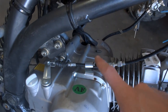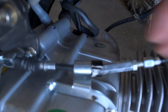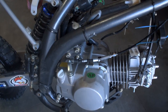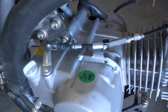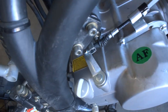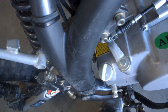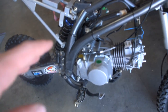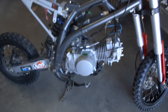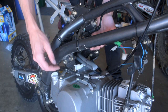Long story short with the clutch cable, we ended up building a little spacer — we notched it and slid a piece onto the clutch cable because this is meant for a 125cc and this is a 150cc, so the length isn't right. I've got it so it actuates and pulls the clutch lever, I just don't know if that's enough to fully engage or disengage. I don't really want to burn out the clutch, so I'm going to quickly test that out when we get it fired up.